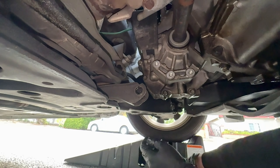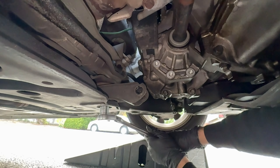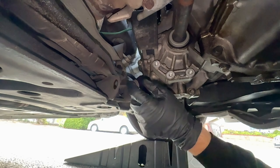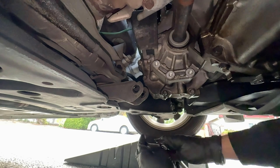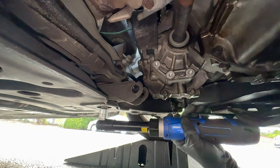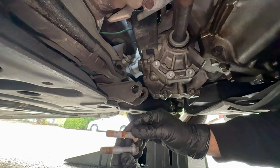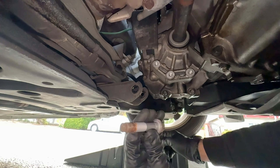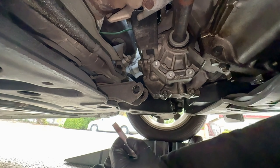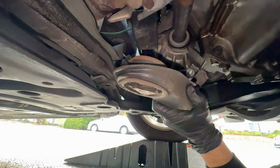I don't like that flex - I mean it's normal flex, but putting a new one doesn't really hurt, especially since I'm not charging the customer all that much. Just go ahead and take this out. Looks like this - put it down and take those out. See how it flexed? Just flex it back without an issue. Don't lose the 14 millimeter bolts. I'm gonna go ahead and remove this 17 millimeter bolt now. Just memorize the orientation - the open side is toward the top and the closed side is toward the bottom. The right bolt is for this mount and the left one is for the other mount, so don't mess them up.